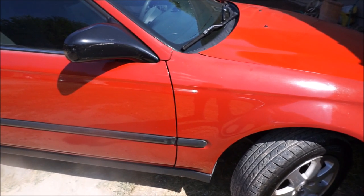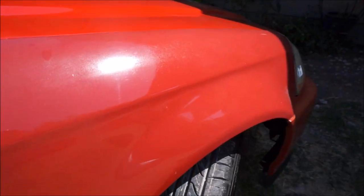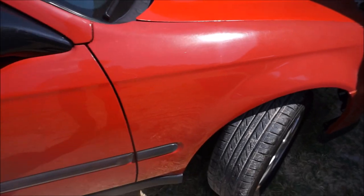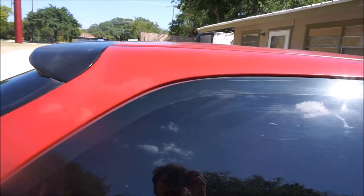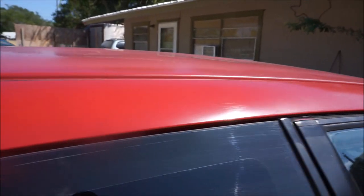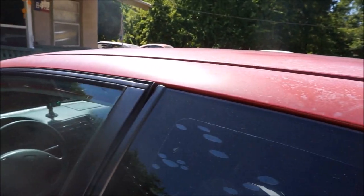Just got done doing a full three-stage polish on the fender and once again this really impressed me. Not really any swirl marks — it all came out really nice. The paint is in a little rough condition over here, but comparing that side to this side it's looking really nice again. I did actually do some light sanding on part of the car and after the sand, polish, and buff it came out looking nice and shiny. Let me show you what the other side looks like for reference — yeah, this is what it looked like before, still a little faded, but now it's looking a whole bunch better.